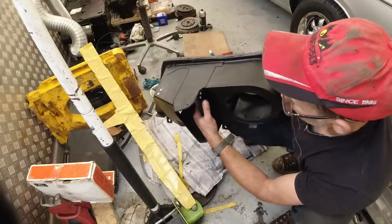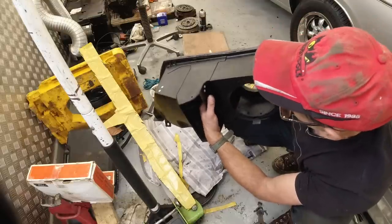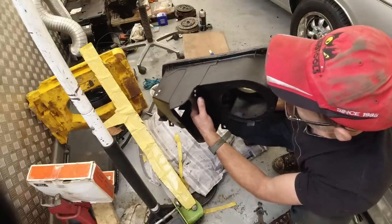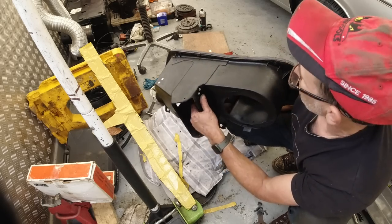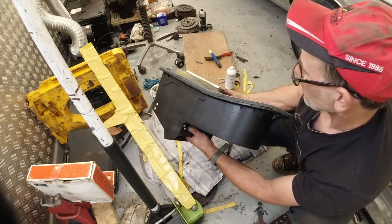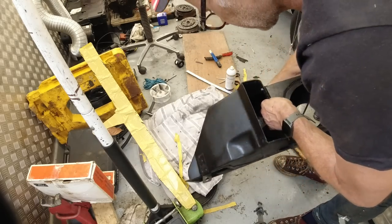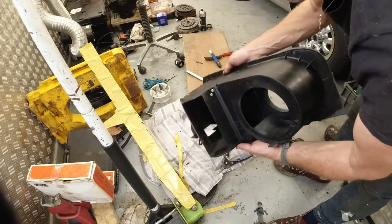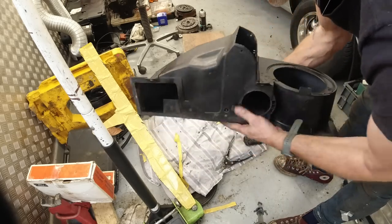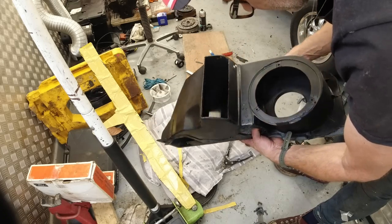The flap actually isn't strong enough to compress the foam and make a proper airtight seal. You actually get a better seal by having it clean. It's a bit more rattly, but you only hear that once, one operation. So that's done. I can take it back to the car, go and get this in and get the matrix fitted. And we're all good to go there. That's quite nice for just a quick 1 hour. Just goes to show you can still get these. They're still out there. Let's go and fit it.